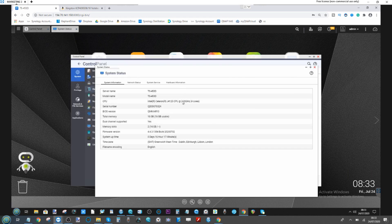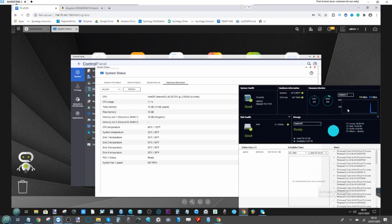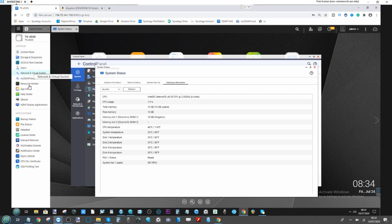I've noticed we're not actually seeing the memory listed at the top of the control panel, which I'll be honest isn't ideal. Let's go into the hardware info center. It does state that it has two memory slots and 16GB. Going into more detail, we can see it has recognized the 16GB Kingston memory module. It's also stating there's 14GB currently available, which is because the system is using around 2GB to run the background applications and the RAID we pre-built. So we've replaced the original 4GB default module with this 16GB Kingston and it has been recognized.